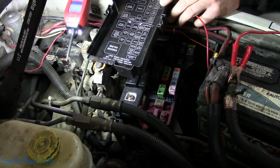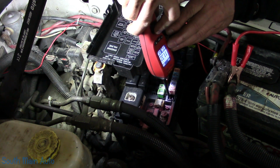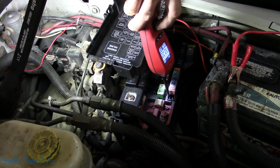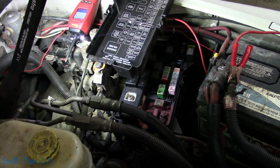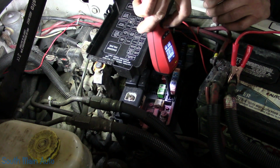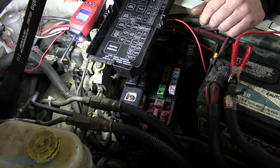That's hilarious. Let me turn on the marker lights real quick. Okay, the marker lights are still on. Let me just power this up. I don't see the marker lights kicking on. Let me open the door, see if we hear the dinger go off. Okay, the door is open. Okay, so we're missing a fuse.